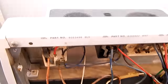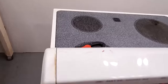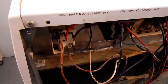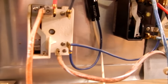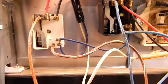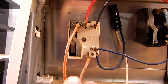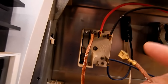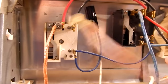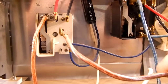The first step in troubleshooting is when you turn the switch on and the burner doesn't light — you need to figure out: is it the switch or the burner? With the range still disconnected and no power, we're going to test continuity to the burner itself using the H1 and H2 wires. You're going to unplug one of them and measure resistance going through one wire, down through the burner coil, and back up to the switch.